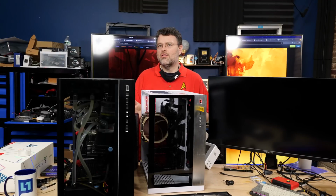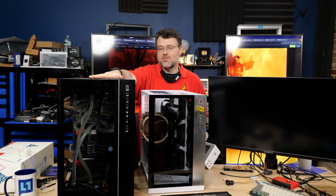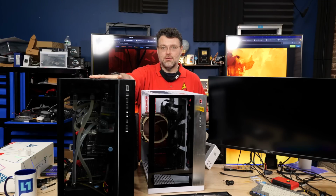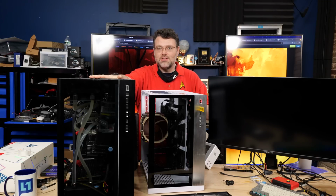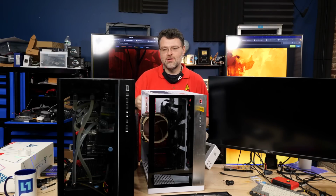Well, that's the joke. Another way you can look at Sapphire Rapids power utilization is, okay, this is my W3175X system. I've got two 360mm radiators and a 1600 watt power supply, and the radiators struggle to keep it cool for the overclock that I'm running. And it's been 24/7 stable for 4 years. This actually uses less power and is more gen-on-gen gains than this. So a couple more generations of this and it's not going to be like that anymore. It's actually going to be much lower power and much higher performance.